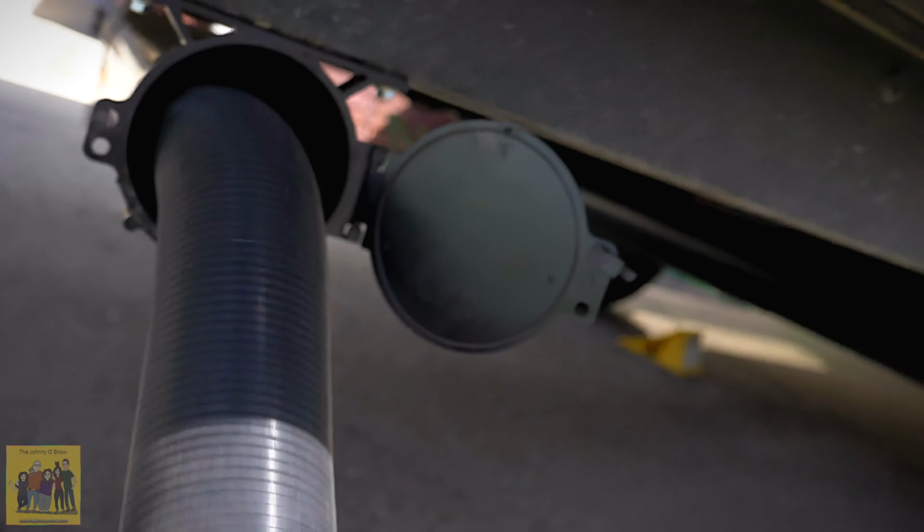Also, when I got my first pipe, this one end was not attached. And you could probably glue it again with just the PVC glue. But if you look at these, they used a hot tool, and it's not a rivet. They melt it with something, and it melts all the way through the pipe, and that's what holds it into place. So I just used my solder iron and stuck it right in there and melted it. As you can see right there, I just melted it with my solder iron. They only have 3 points where they did that. I went ahead and did it in 5 points. So basically I just remelted it, and that secured it on. So that's one way to do it.